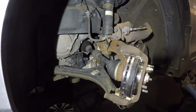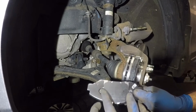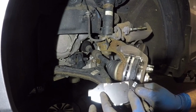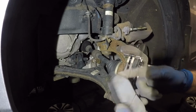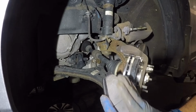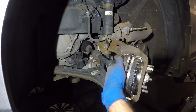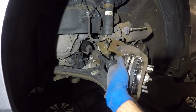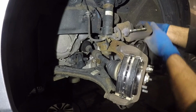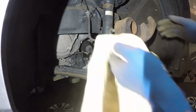So scrape it enough so it moves around easily, all right? And the brake pad on the inside, guys, is gonna have the pad that's gonna go inside. If you're using this type of branded brakes, it's gonna have a different little shim here, and it has a sensor inside. I like to usually keep the sensor on the top, so when the car is gonna reverse, it'll squeal. All right, so there it goes, and that's it. I didn't even have to look back there, right, guys?